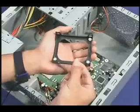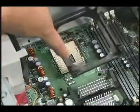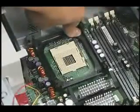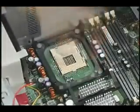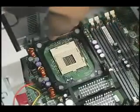First, remove the 4 white push pins from the RM. Place the RM on the motherboard, aligning it with the 4 holes located around the processor socket. Push down on the 4 fasteners to secure it to the motherboard. Use the white push pins to lock the RM into place. Gently lift up to ensure the base is secured to the motherboard.